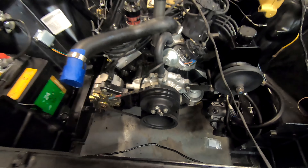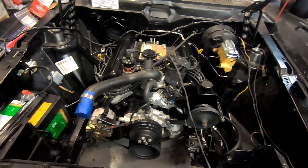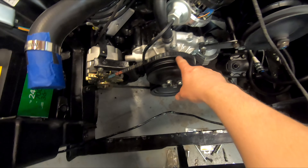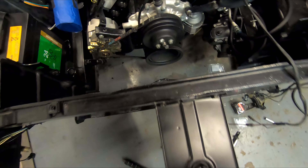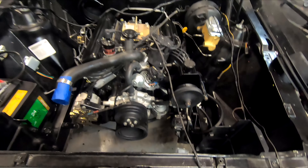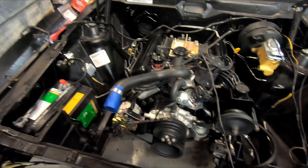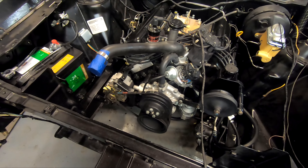As I said before, I already got the alternator belt on there with no issue. I just got everything loose so I can make some adjustments to the power steering to get it all on there, and it was really tight. At first I didn't realize why, but it's because the belt depth is too wide for the groove. I think it's going to affect both of these — I have the crank pulley and the belt fits fine on the crank pulley, but I'm assuming this is a pulley from a Jeep. I'm going to have to look through everything I have because I might have to find a Jeep application belt for this, if that even exists. So yeah, that's going to be fun.